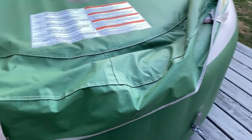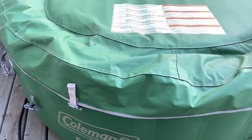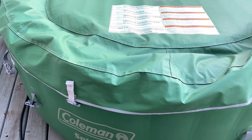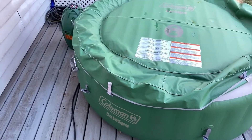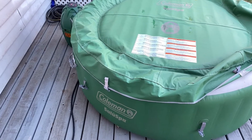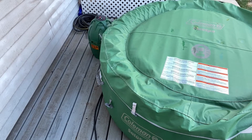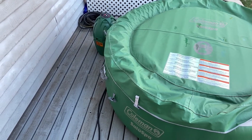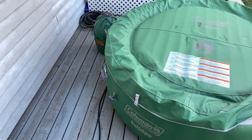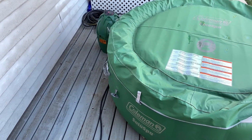What happened was we had a massive windstorm and it blew off the cover because I never latch it — I'm lazy. Anyway, it filled quite a bit of dirt in the water, some leaves and debris. I'd also just put in quite a bit of epsom salt the preceding day, so I'm not sure which issue was primarily at fault. But it ended up clogging up the flow. There's a little flow meter inside that egg, and if the water's not flowing at a certain velocity it'll create an E02 message that shuts off the motor, and you can't heat it or do anything with it.